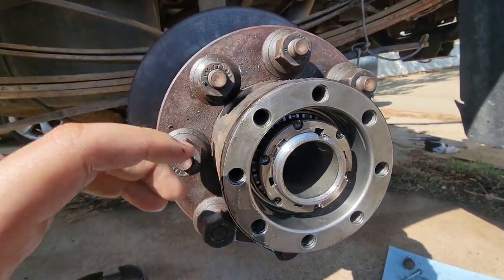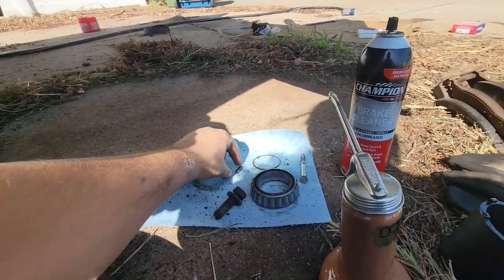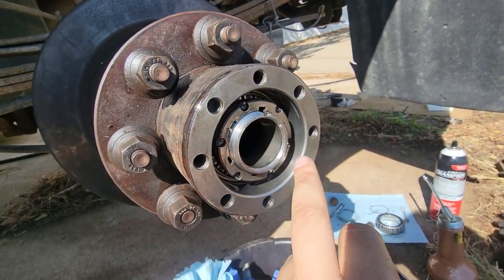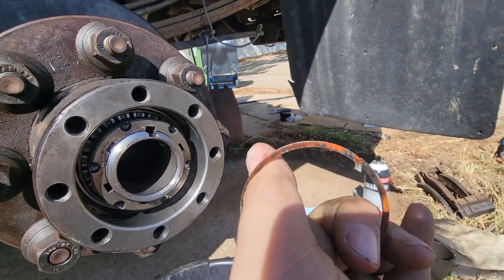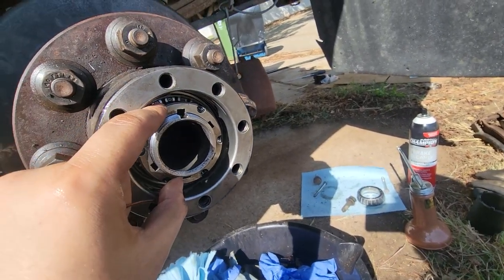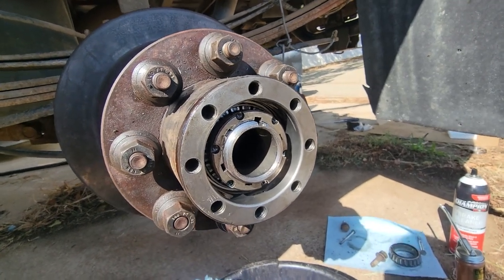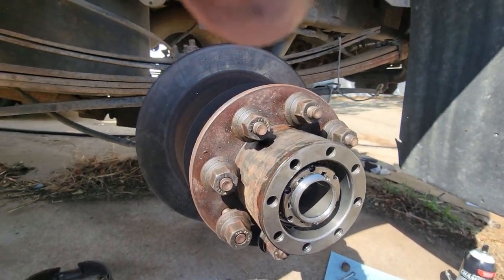The oil comes through this tube and fills up this whole outer section — that's why there's a gasket on the outside too. Now I got to clean this little piece, fit it inside that keyway, take the snap ring and get it around the outside — make sure it's buttoned up. There's that little lip right there that goes on first and goes inside that little hole to help keep that pin in place. This pin keeps it from moving. Anyway, I gotta put the seal on, wipe down the axle — I already inspected it and the axle is fantastic — get the seal on and get this bolted up.